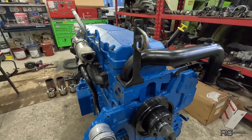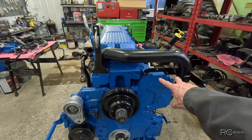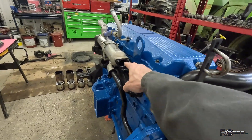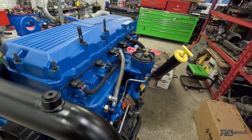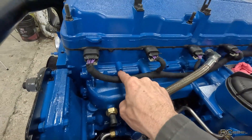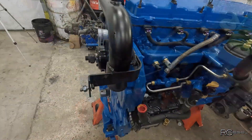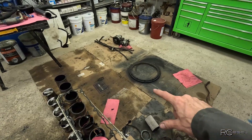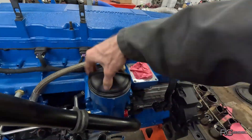I'm having to jump around a lot because I'm getting down to the nitty gritty and there's always something — some bolts I forgot to paint, or something holding me back. I can't tighten those ones up because I don't want to tighten this bracket up — it's on slotted holes. I don't want to tighten that bracket until the EGR crossover tube is in, but I can't put the crossover tube in until the intake manifold and EGR valve are on. And I don't want to put the intake manifold on yet because I have new clips coming for the injector harness. I also forgot to paint the ring on the back of the bell housing so it's just drying right now. I got my new fuel filter — the right one — so maybe we should put that in.